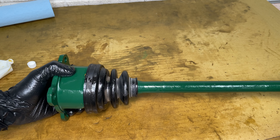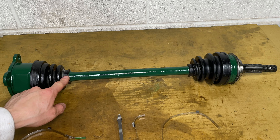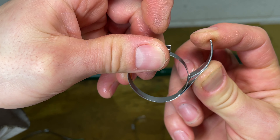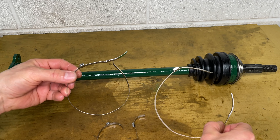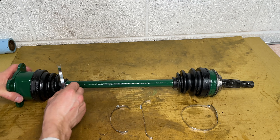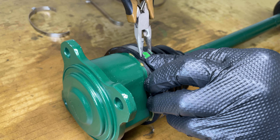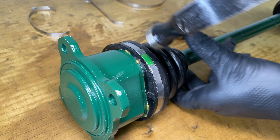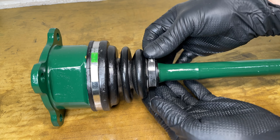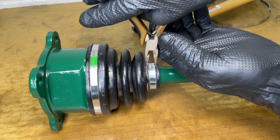It's time to install the boot clamps. Comparing the smaller clamps, you can see the left side is slightly bigger than the right. The way these work, you bend them into a circle and there's a little tab and the outer piece catches into it, then you close it. The larger clamps are different sizes too — the inner CV joint is slightly bigger than the outer CV joint. The big clamp doesn't come apart, so slide it over the axle, then just close it. This takes a bit of force because there's some grease between the boot and the metal that needs to get pushed out. Squeeze the tabs together with small pliers, then tap them down with a small hammer, giving the tabs another squeeze and making sure everything is tight.